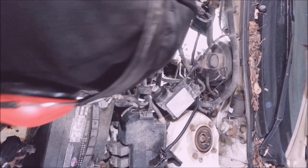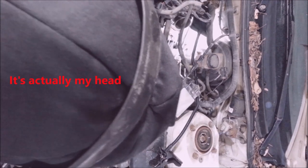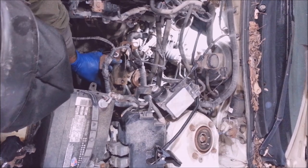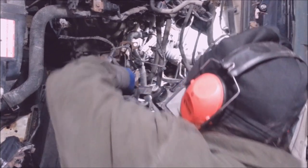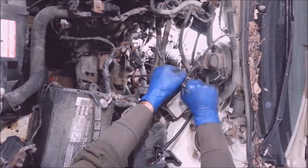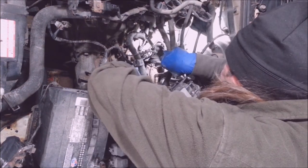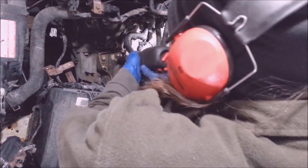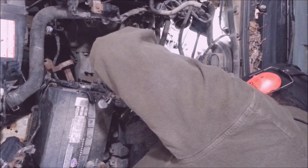As a precautionary measure I'm going to duct tape this piston down to make sure it doesn't fall out — push it all the way in. This is a 17 millimeter here on this mount. If I'm lucky I can put a jack underneath the transmission and jack it up just a little bit, pop this bolt out. There's a big-ass fuel filter in my way — two 10 millimeters on this fuel filter. Got that bolt out, more 17 millimeters on here, and there's one more 17 millimeter hiding back here for this mount.